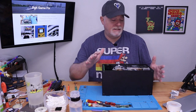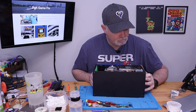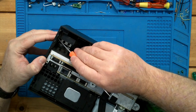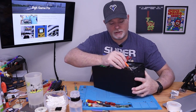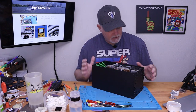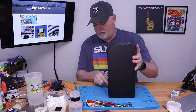I'm actually very glad to see that nothing is being forced on these new Xboxes. Here's the clasp for the bottom. You can see it underneath the catch. But I'm glad to see that, once we release these two pins, this entire back came off. We didn't have to yank or break anything. I know Xboxes in the past have been pretty rough on getting into them.